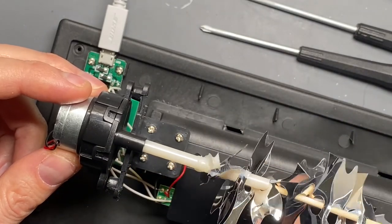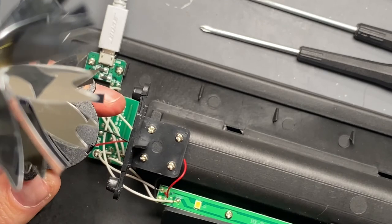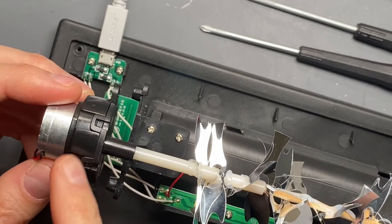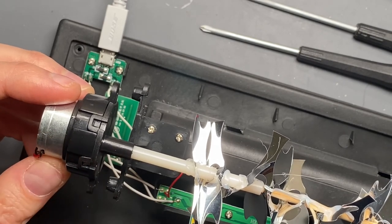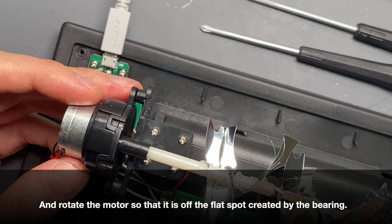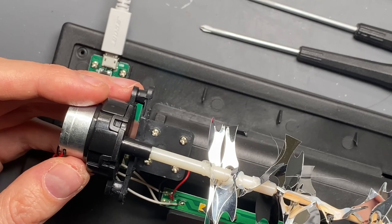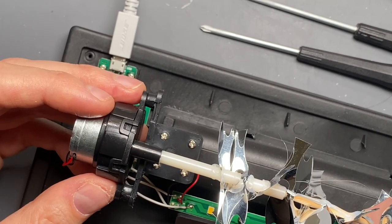Great, so there you go. If you have one of these things and it's making a bunch of noise, those are the two things I would try: take this apart, gently open up the gearbox, and check that all the gears are lubricated and that the oil hasn't migrated to the top of the gear where it's not meshing with another gear. Then remove the motor with the two screws and lubricate the motor's bearing — that little sleeve bearing sitting in the front. It's definitely quieted it down, and I'll mark the date and see how long it stays quiet for. I hope it helps you if you're annoyed with your fireplace effect making noise. Thanks for watching — please like and subscribe.